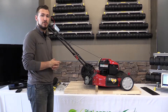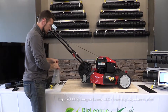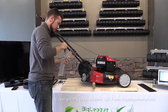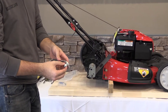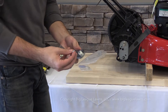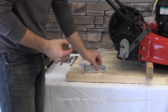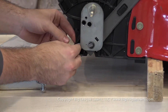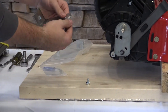Now we're ready to start installing the Checkmate Striping Kit. The first step is to install the mounting brackets to the hole we identified earlier. Grab your hardware pack — inside you'll find one of the mounting brackets with hardware pre-assembled in the order it will be mounted. Unthread the bolt from the connector nut and set it aside. Take the three nylon bushings that were on top of the connector nut and place them into the hole where the rear skirt was.